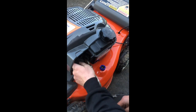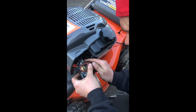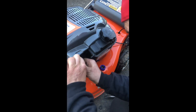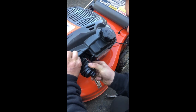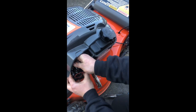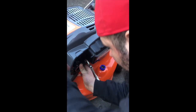I'm having trouble with the, what you got? Alright, you know what, let's try this way first. Alright, we're gonna try, so off the engine first, like this, because then now it's vertical, right? And then that's when you can slide the one off the exhaust. So hold that, slide it in like so. You cannot get these linkages mixed up. They're two different widths. So for you to try to stick the big one in the small hole, it's not gonna work. So it's pretty much idiot proof. All right, that's in there. Press it in nice and tight against the engine.